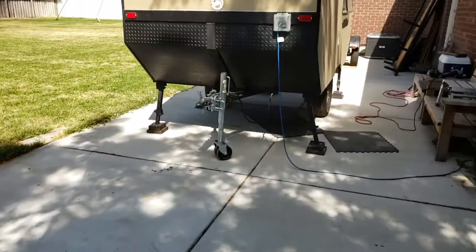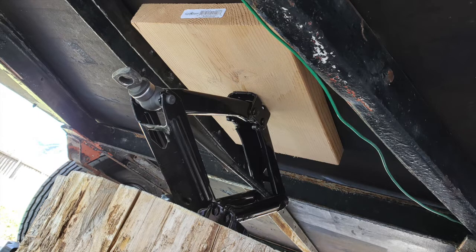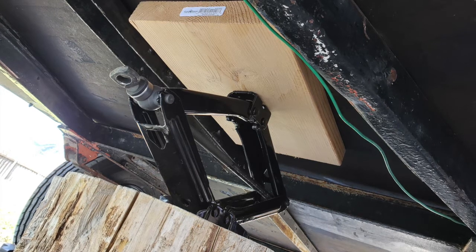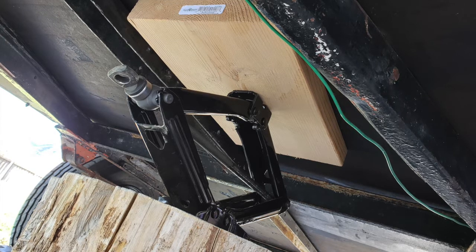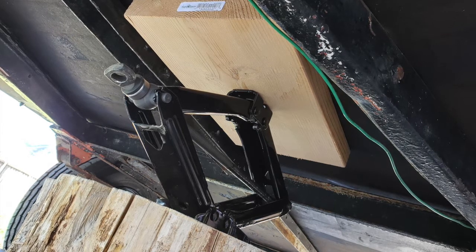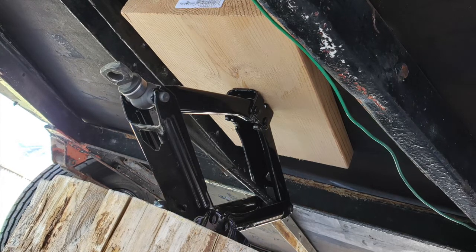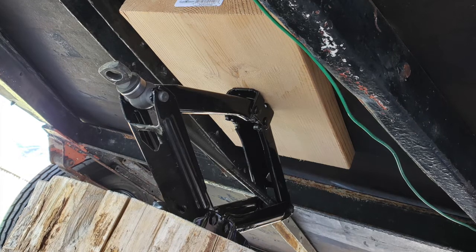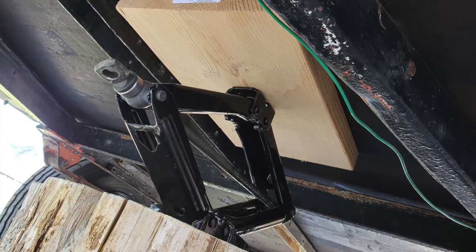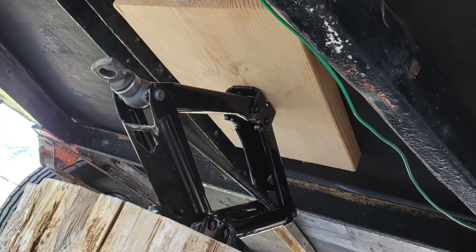I have a large tree stump that's about 20 inches high slid underneath the back end of the camper, then a small piece of plywood between the stump and the jack, and a section of 2 by 10 between the jack and the bottom of the camper. The idea is to place that between the frame members and apply pressure over a large area — just enough to lift the camper up about five or six inches so I can slide the four by fours between the cabin and the frame.